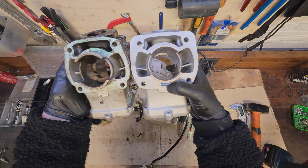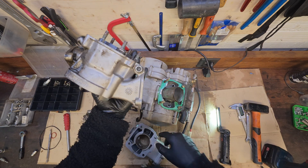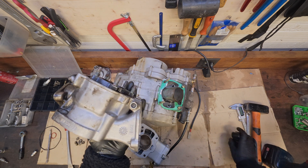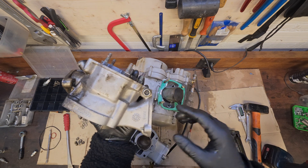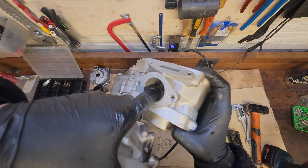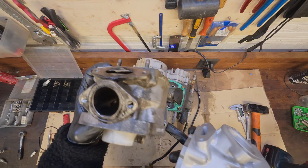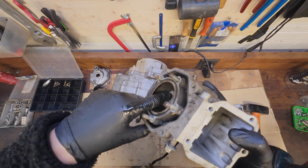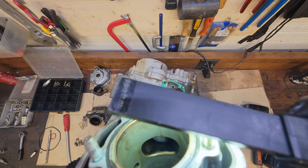Except this port is not existing on this one because it's one of the early model cylinders. It's actually a 220b, so from what I read it's from the Aprilia Pegaso — the touring enduro bike. I'm not sure if they make the same power as the other ones. On the intake side there's a big difference: these ports here on the side are non-existing on this cylinder.